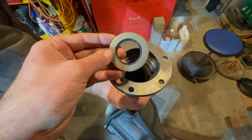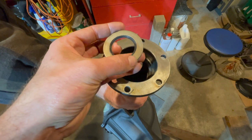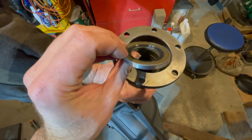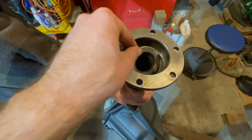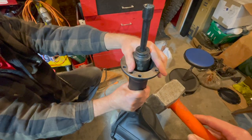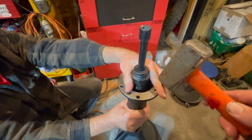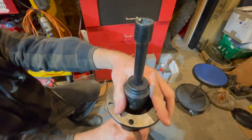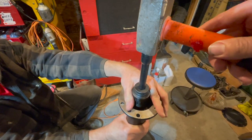This is your inner axle oil seal and we're going to make sure we install it in the right direction. You want to have it so the more metal part is facing upwards and the lip is facing inwards. We'll have to drive it down using a hammer and a large socket — standing your axle on end, make sure that your drives are nice and square. We're just using a 1-7/16 inch socket with an extension on it and hitting it with a hammer to drive your oil seal down.